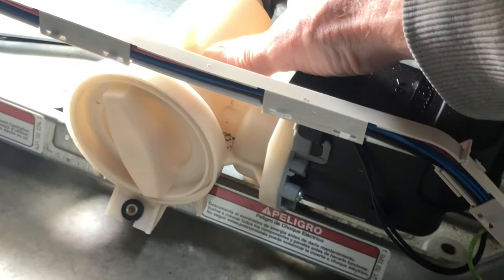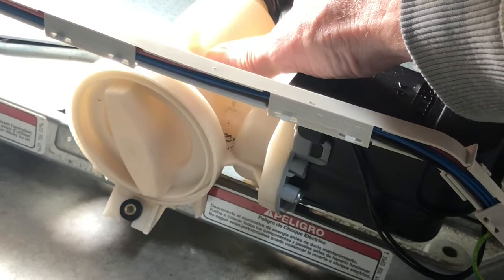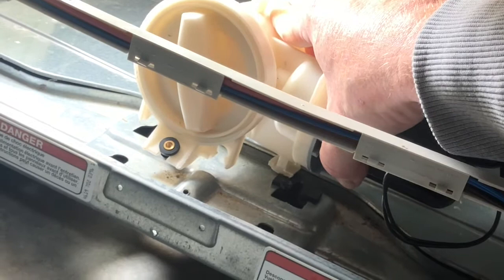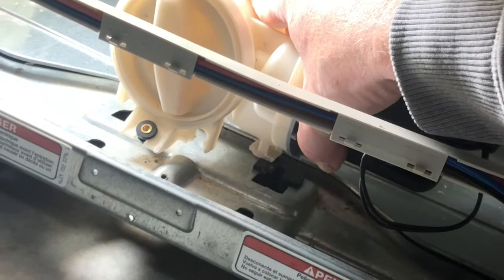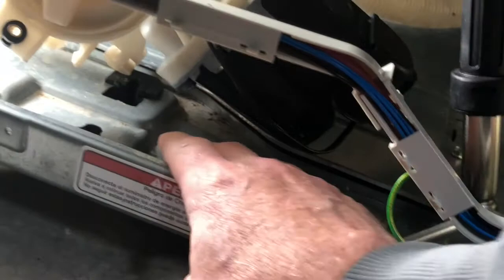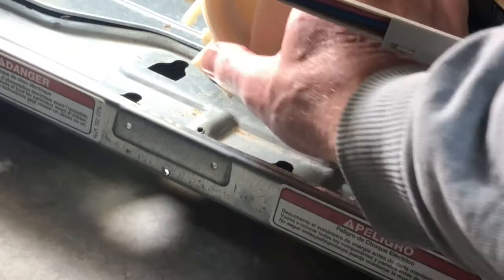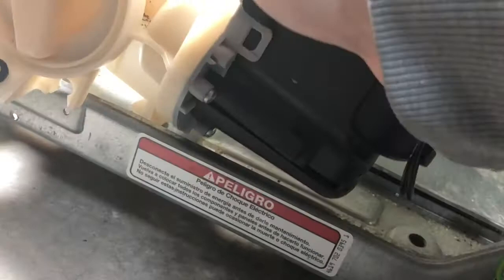Most importantly, this allows you to tilt it down. That tilt will let all the water flow out of the coin catch directly into a glass pyrex or any shallow dish you can place underneath. Even with propping the machine up, with the pump locked into its footings it's not angled properly — water flows out at quite an alarming rate and runs back down along the grooves of the bottom tray all the way to the rear of the machine and all over your floor. So: panel removed, unscrew the one Torx 20 screw, wiggle free the footings, unclip the plastic harness, and you're ready to drain.